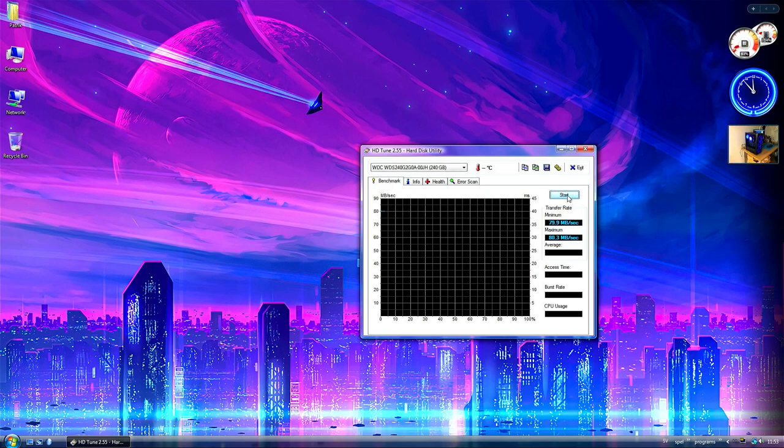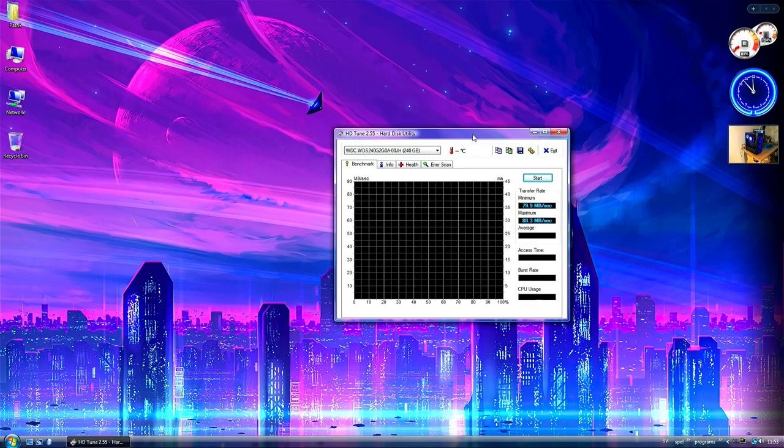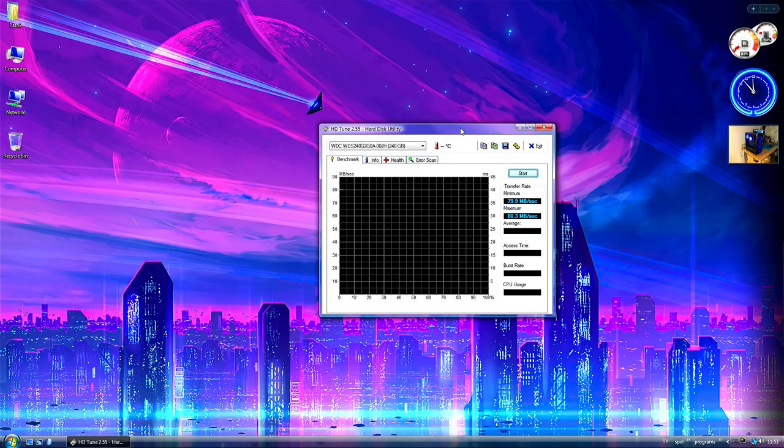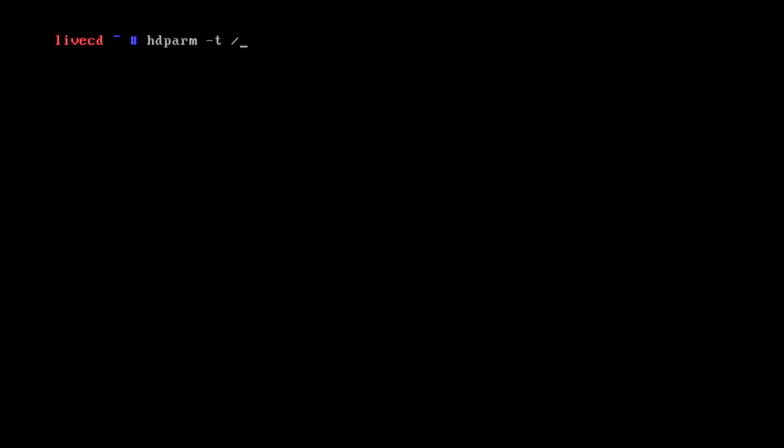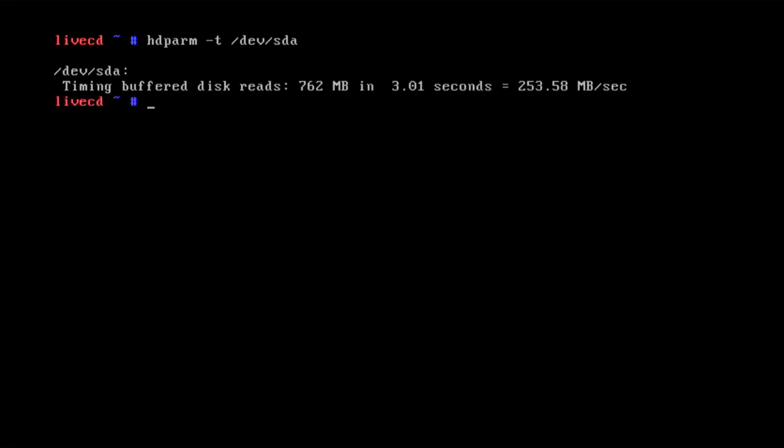The strange thing is though, I had an Nforce 2200 Pro chipset. It's for Opteron, supports SLI like this. It's basically like the workstation version of this, and I had like 275 megabytes per second in Linux with that back in the day. So I booted up Linux on this and ran some hdparm. It's a kind of quick and dirty test, and that scored 250 to 260 megabytes per second. So the Linux driver does work much better. Apparently the Nforce drivers from Nvidia, their own drivers, are notoriously bad.